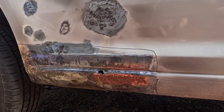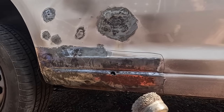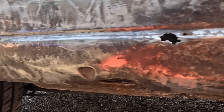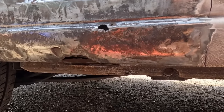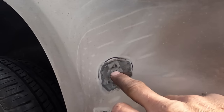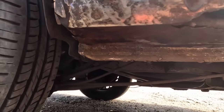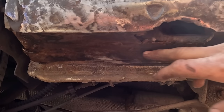So Andy's been in there for about 40 minutes and he has stripped back to bare metal. We used the flap disc and then we used a wire wheel on a drill, and that gets some of the extra rust that's in the pitting. So we need to get as much out as possible. Now don't get me wrong, this isn't going to last forever, but it will last a lot longer than just lashing it up. We've got enough of the surface clean, and he has gone far enough back to expose all the rust. That is the rust, and that blows out bigger. We do need to do a little bit more underneath. Let me crouch down. So we need to get some more of this brown off, make it look a bit prettier.